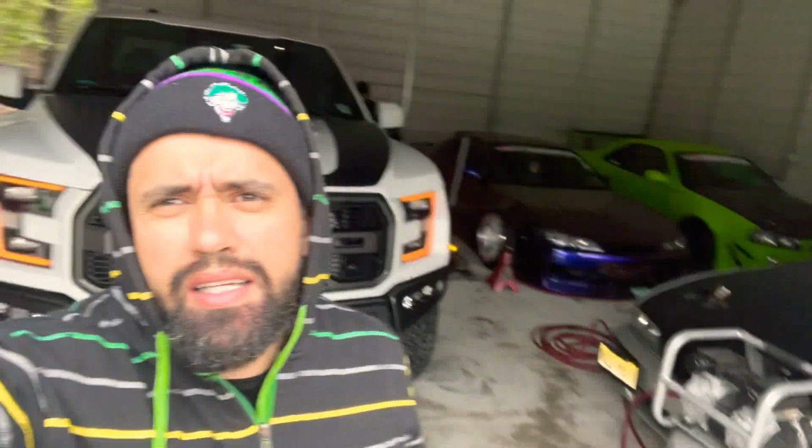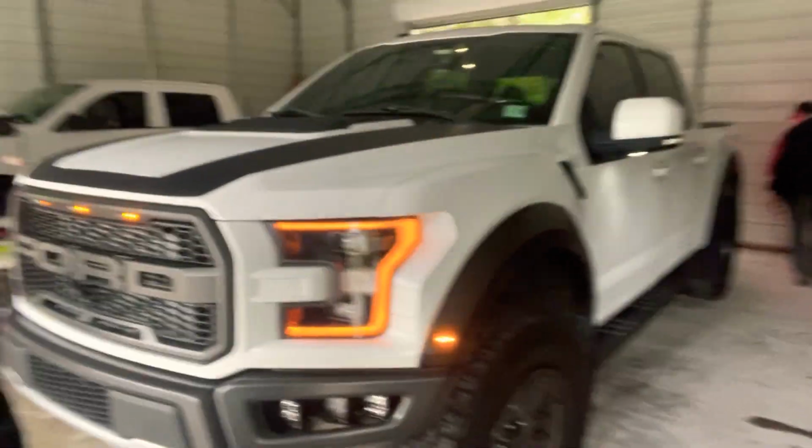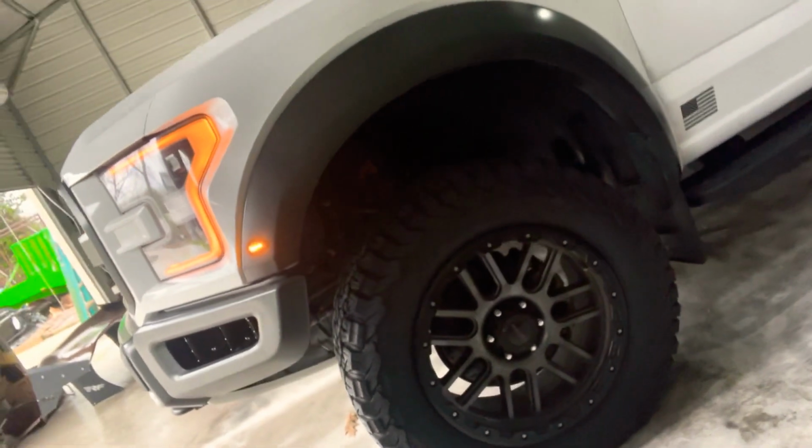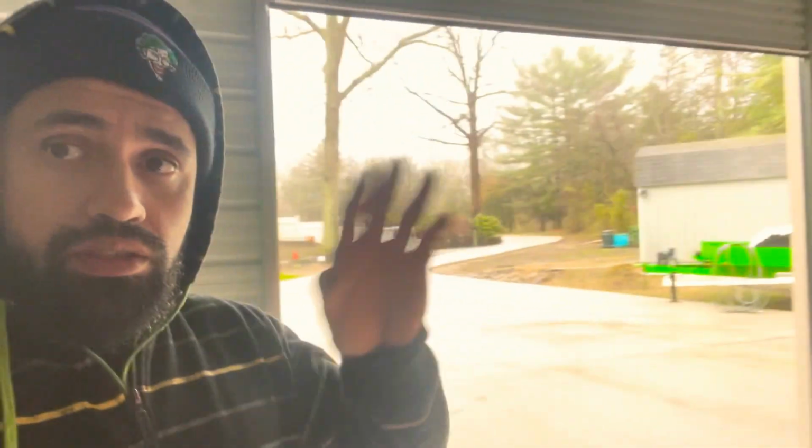All right, she's all back together. Everything came out really, really good. So now we're gonna push the brakes. Whenever you're done doing a brake job, always push the brakes first until you feel it hard.